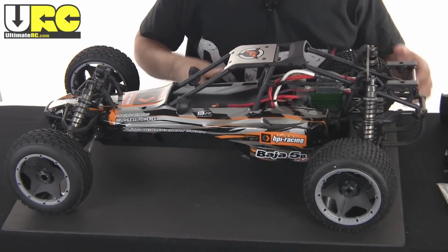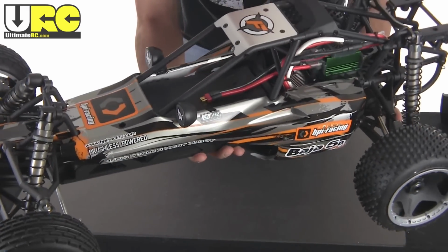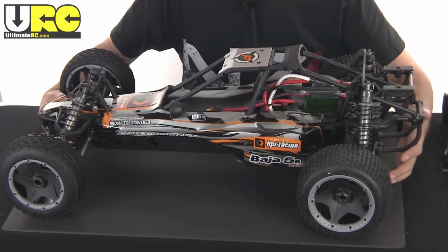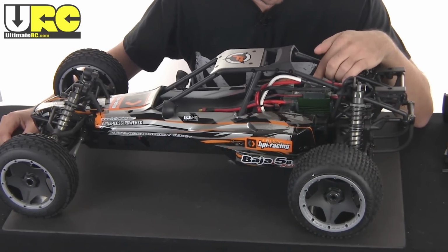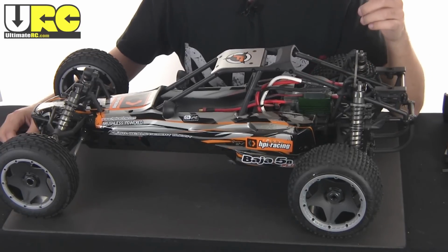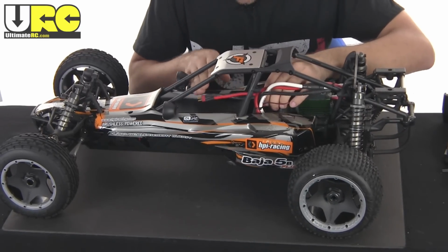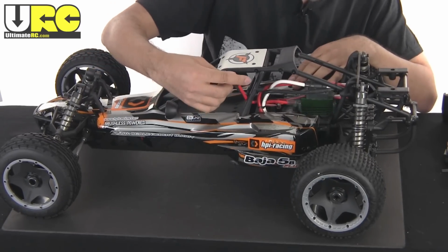The motor on this thing, you'll have to take a closer look at. Not sure if you can quite see it in there, but it's huge. It's larger in diameter than a Red Bull can, and probably similar in length to one of these smaller Red Bull cans. Castle system, obviously. It has the Castle Mamba XL2 extra large ESC with heatsink all around it, and a nice fan on top, and huge caps coming out the side. Let me see what gauge these wires are. Castle Creations 8, there we go. 8 gauge wire that all comes down to one single little Dean's connector, which is kind of comical by comparison.